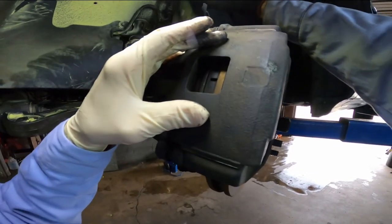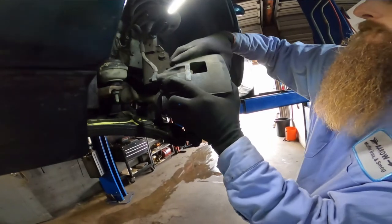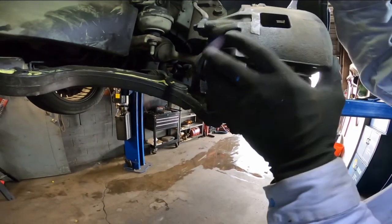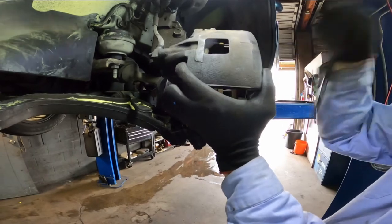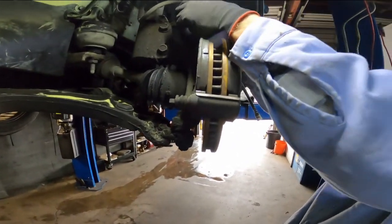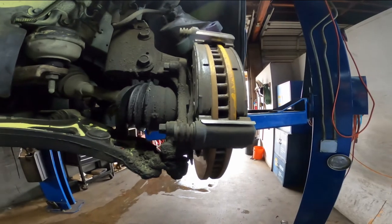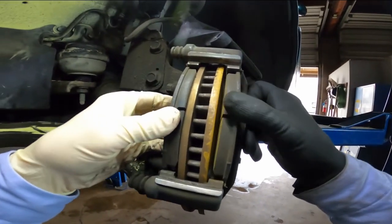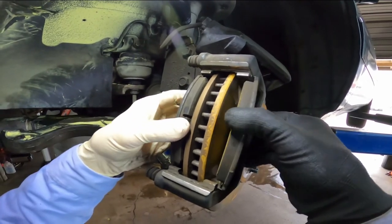You don't have to replace the whole caliper — the money is good for the technician. Now, getting back to friction material: at AutoZone, O'Reilly, and Pep Boys they'll say, 'Would you like to upgrade to ceramic or semi-metallic race car?' Here's the problem — most of the time people coming in to purchase brake pads are either having a grind, meaning they know their brakes are bad, or they're having a squeak. Quite often people attribute that squeak to the composition of the pads, but most pads don't cause squeaks.